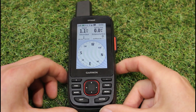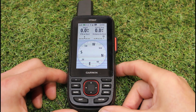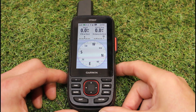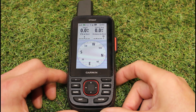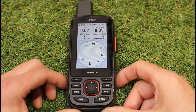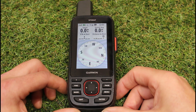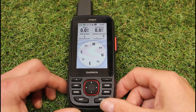We recommend recalibrating your compass when you've moved more than 100 miles since your last calibration location, after big changes in temperature conditions, or if you have a unit with removable batteries and you've just changed them. Also recalibrate if you feel the unit isn't lining up correctly — perhaps something magnetic or electronic has interfered with the device — or if when you're standing still the map doesn't seem to match what you're seeing in front of you.